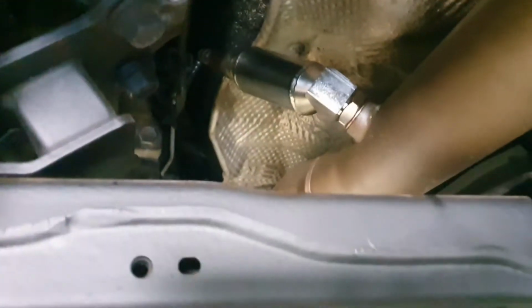So bit of a double up there, but you can see the system all in. We've got our cat stoppers on. These get supplied with the system. They just space out your secondary O2 sensors when we go to a high flow catalytic converter, so that your computer is tricked into thinking that everything is still stock standard under here from the catalyst point of view. So that's all that in and done, bolted up at the front.